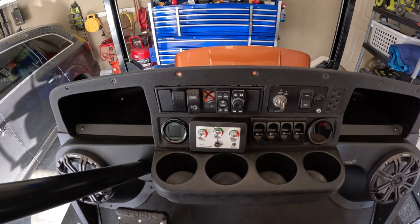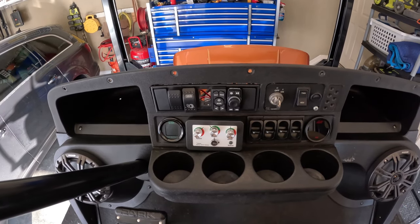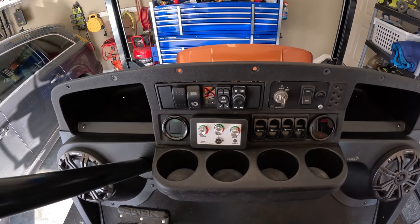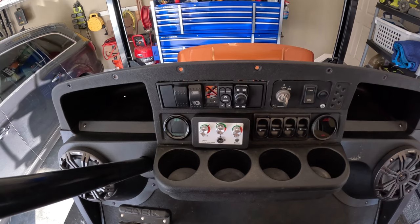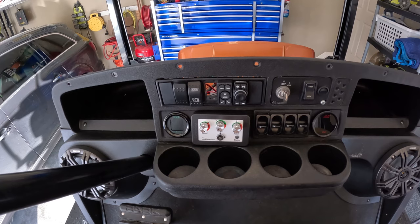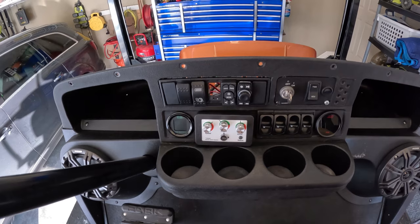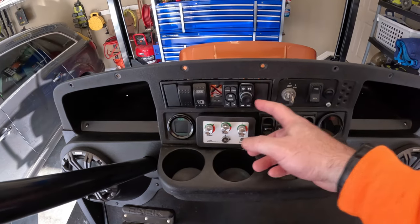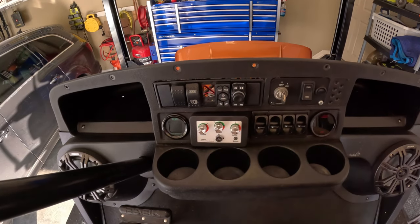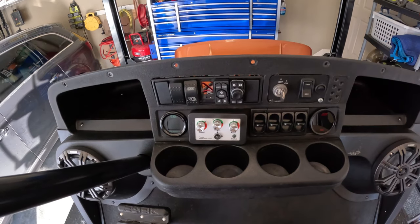The only downside of this SSV Works is it doesn't have any bass or treble control. These speakers are a little smaller, so if I play music with any bass I run into some bottoming out. I think I'm going to need a low-frequency blocker on the speakers, somewhere in the 120–150 Hz range, to eliminate that bottoming out sound. Other than that I'm really happy with it. I chose it over the Wet Sounds and others because it has a rotary knob — I prefer rotary volume control.